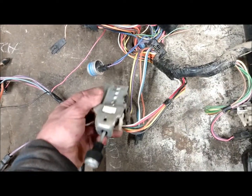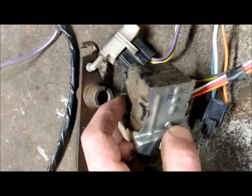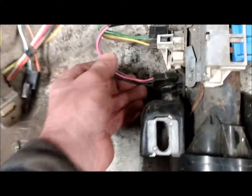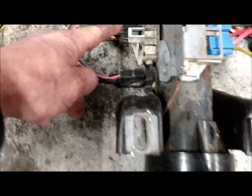You've got your headlight unit up here. There's a little pin right here you've got to press in — it's got a little spring on it. You want to pull it all the way out completely, press this button all the way in, and completely pull out the switch. Over here is your wipers; you can break that connector and put the pulse wiper in there.